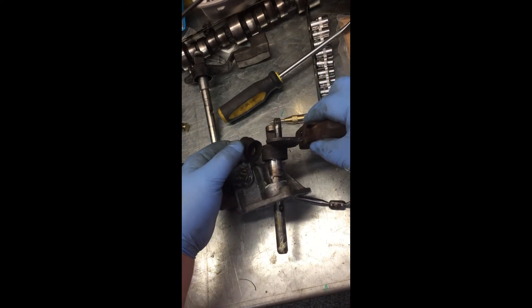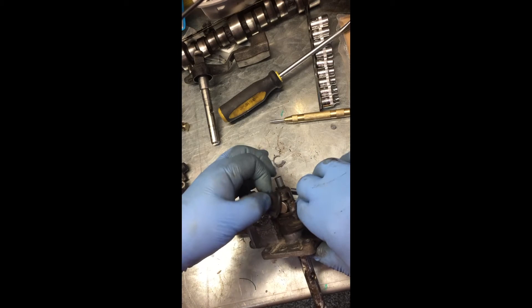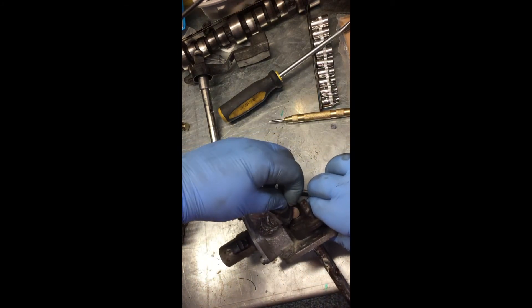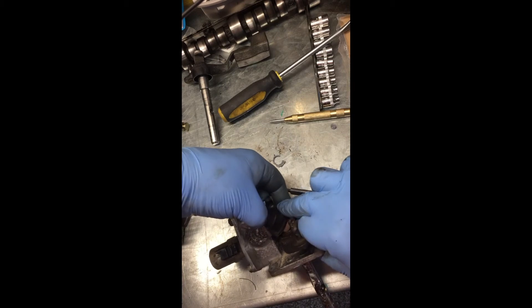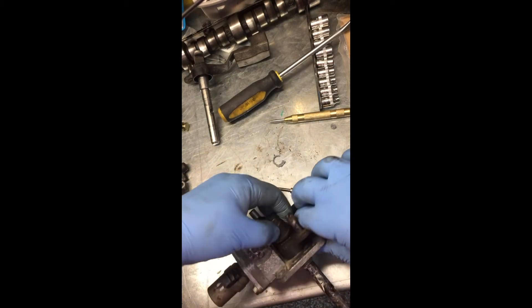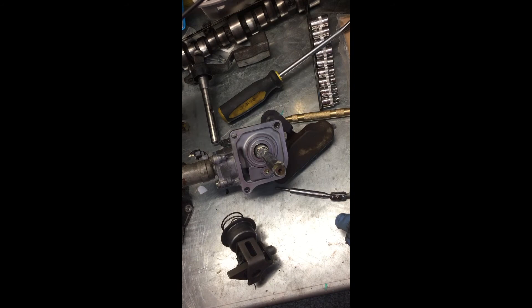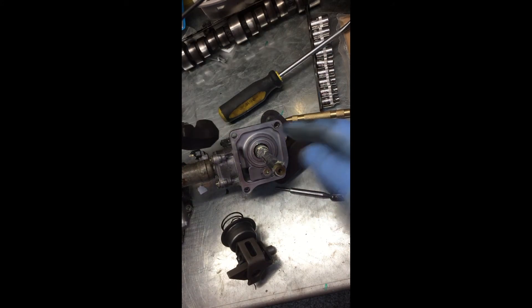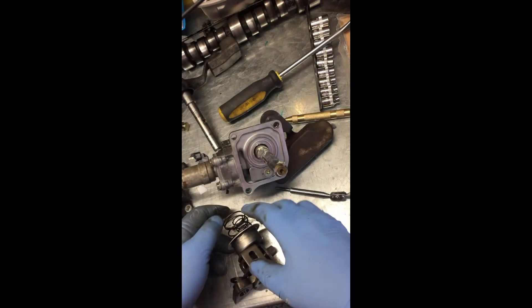Once that's all done and I've welded the tab up solidly, I reassemble it — put the shifter selector shaft in, the lockout lever in, and cover it with the boot. Make sure you get the boot on first; it's a bit of a challenge, but with the magic of editing it only took a few seconds. Once it's all together, the shifter arms are in the proper location for the shifter cables, the counterweight is on the correct side, and I have the housing that'll bolt right back up to my five-speed.